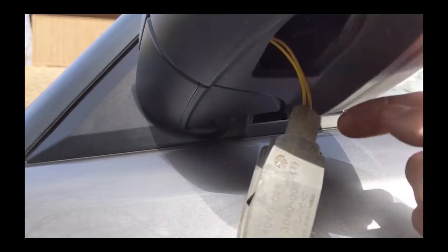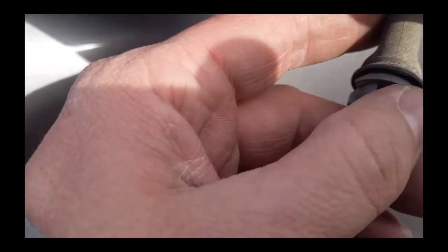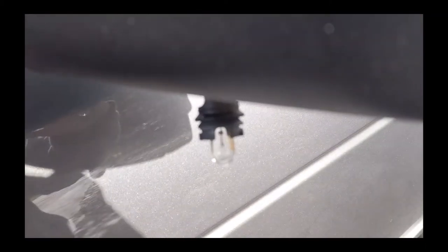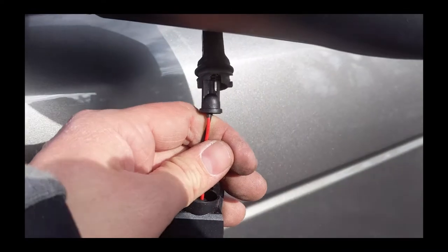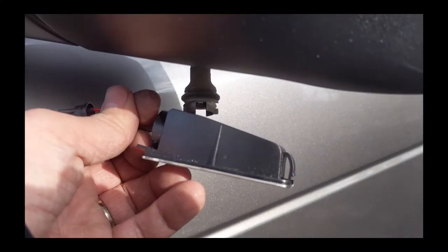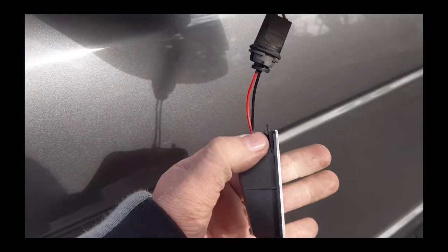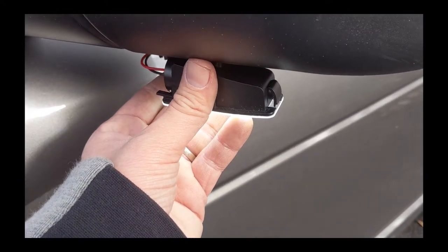That's because this is going to physically plug into the LED — there's not going to be a bulb inside. So for the puddle light, you're going to take the bulb out. With the bulb out, the LED is going to plug in where the bulb went and then go back up inside. Then that's plugged in, and you can see how bright this new puddle light will be. Then you're going to fit that back up inside.